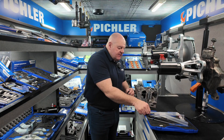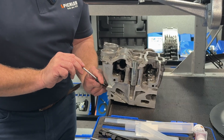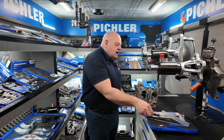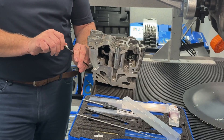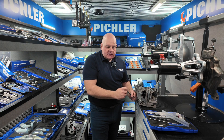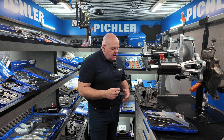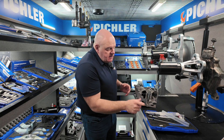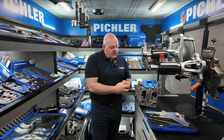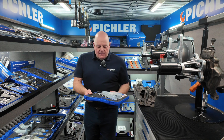You just need the top guide then. The taps are machined to fit exactly, so you get a nice guide again and you tap into the tip exactly. Once you've tapped into the tip, put our pulling spindle down into the tip and you can either draw it out or slide hammer it out depending on what you want to do. The slide hammer is easy — we do an attachment where a little mini slide hammer goes on and you just pull that tip out, job done. Big time saver — otherwise it's the cylinder head off, or you're knocking the tip in and fishing for it, if you're lucky to get it out.